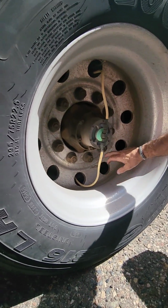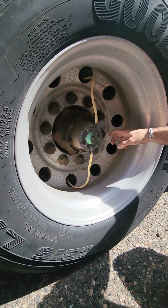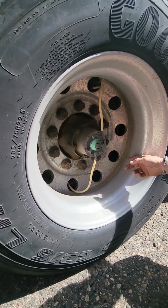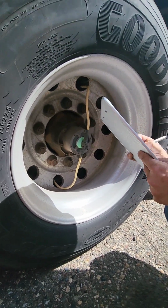This needs to have metal valve stems, which are on the interior on this one, and the air management system, so there are no metal caps, keeps these tires inflated. Hub seals, you need to make sure that these bolts are all accounted for and there's no grease or splatter on the inside of the rims, which show signs of a loose or cracked hub seal.